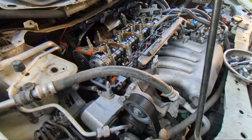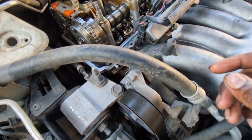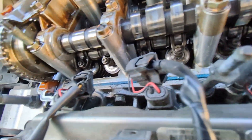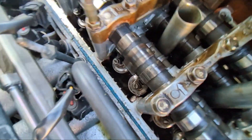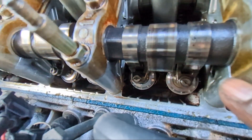Also - is it head studded? It looks like it's head studded. They at least did that. I can't fully tell, but that looks like a head stud down there between cylinder two and three. Yeah, 100% those are head studs right in between cylinders two and three. So apparently they built it to do something. I am so curious about what's going on in this bottom end.